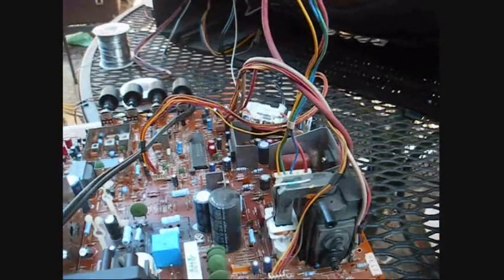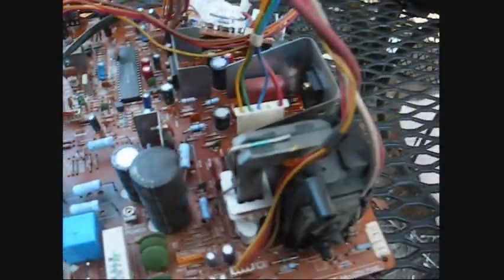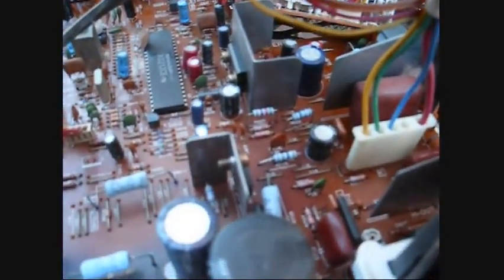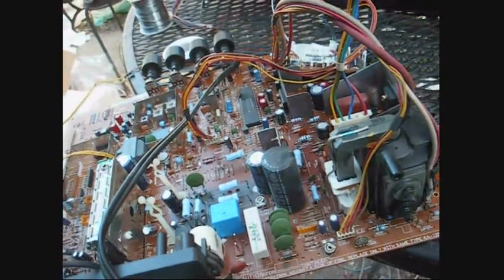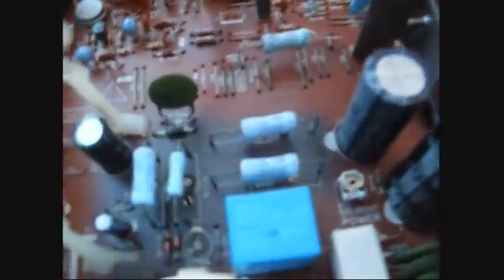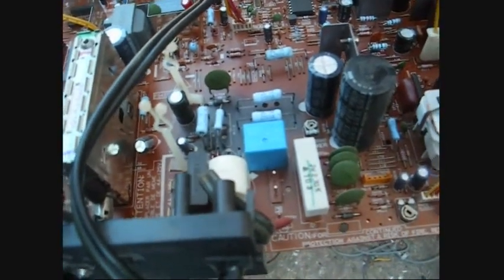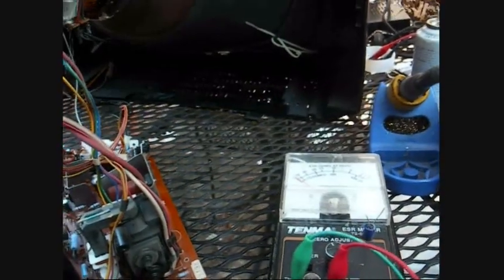Questionable connections are re-soldered — all the power resistors, everything in the power supply area that's gotten hot, the horizontal drive transformer, horizontal drive transistor, horizontal output transistor, flyback, vertical output IC, the regulator SCR, the SCR driver IC. Now I'm checking ESR on key capacitors. This 100 microfarad capacitor down by the relay, located right in the cook zone, is reading wide open on the ESR meter. A new 100 microfarad cap reads zero ohms. I'm surprised the TV would even fire up — so we'll go ahead and replace that.